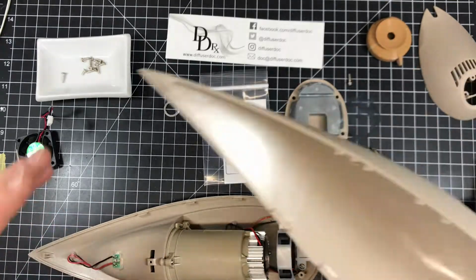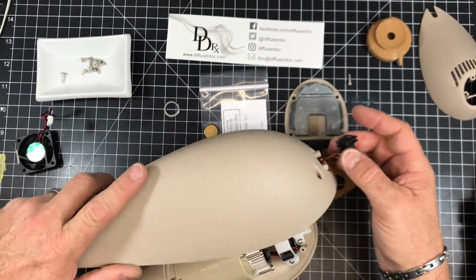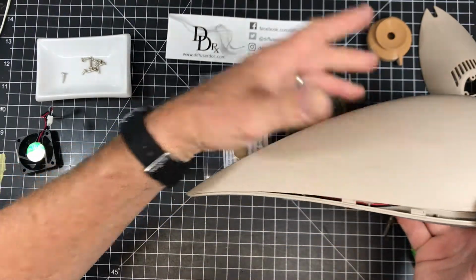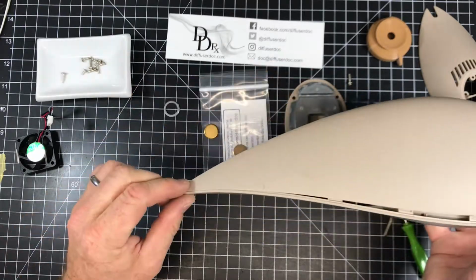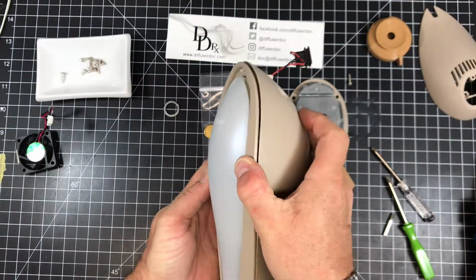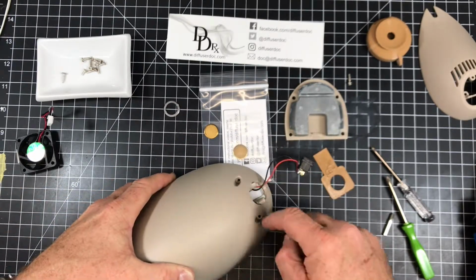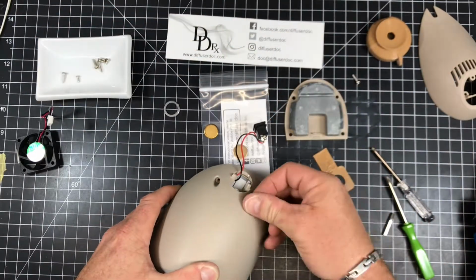So the next thing we want to do is put this back piece on and run the power cord down through this bottom. Before we do that, the first step in reinstalling this is to do this clip at the top. So just make that hook and then push up, pushing this way, and this part this way. Make sure we get that clipped in, and then everything's flush here, so we know we got good contact there. Now push these clips together all the way around. Here are little snaps, and then make sure it's together at the bottom. Looks good. And now these 2 screws. These are 2 of the larger screws that we've taken out. Put them in.